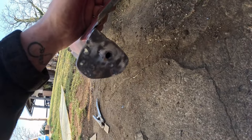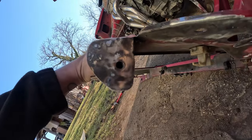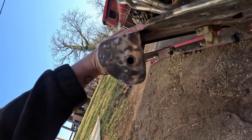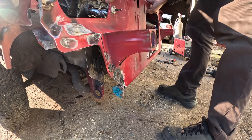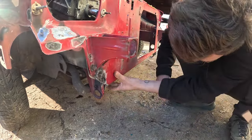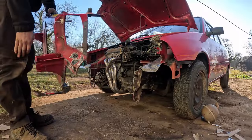Final thing about this section: I have the end caps with captive nuts inside, welded from the back. You'll see once it's finished — even my crappy welds will look okay. Now the hard part: I need to get this marked so I can drill a hole down here. How I'll do that is I'll stick a bolt inside — this is the bolt I can find, that's 8mm. We'll put some green paint on it, put everything back together, and see how deep it goes. And it should be marked now. Yes, that's the spot where I'll drill. Let's drill it here and hopefully for a final fit.